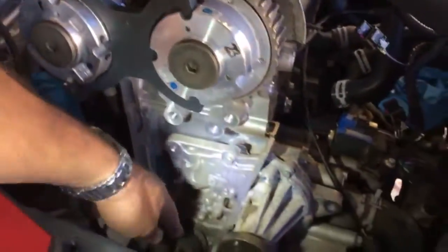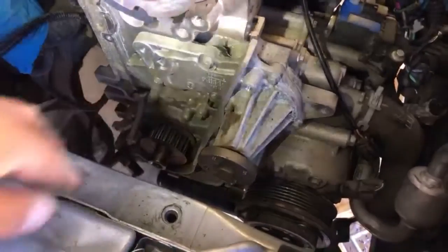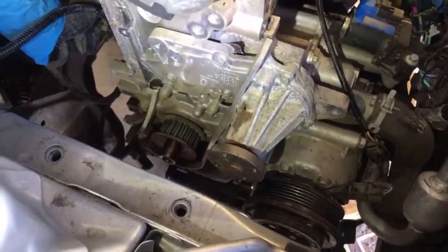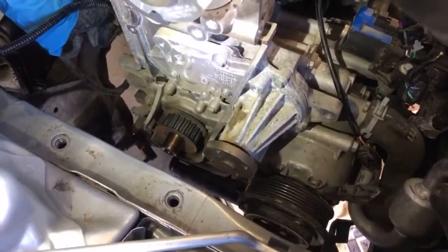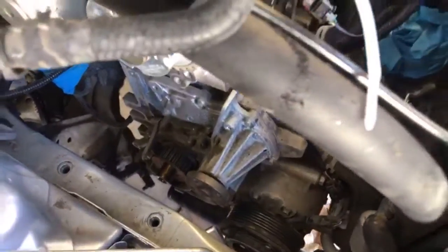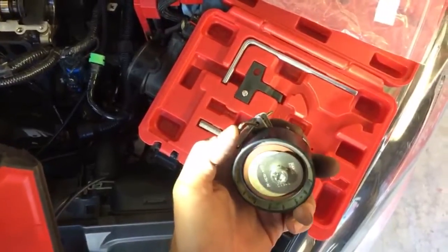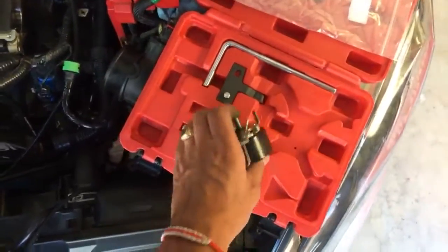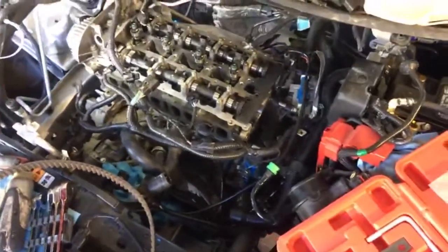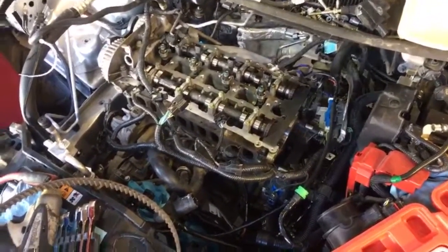So you can see how many special tools you need for this EcoBoost. The pulley is a no-pin pulley, so that's no fun — you have to get everything right, or your belt will get loose, spin, hit the valves, and you're done. This is the tensioner, and there's a special tool that holds it so you can install it. After that you just pull it and it gets everything tight. Once you know what you're doing it's not as complicated, but it's quite a bit of work. Just a quick video to show you that — thanks for watching and see you next time.